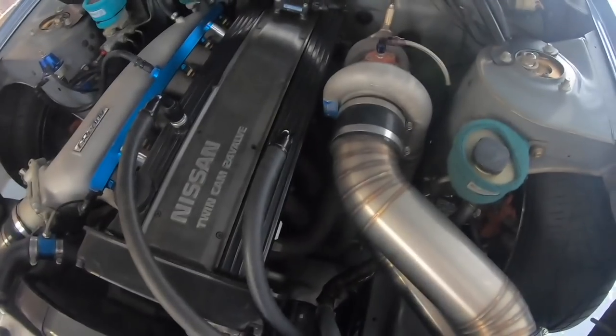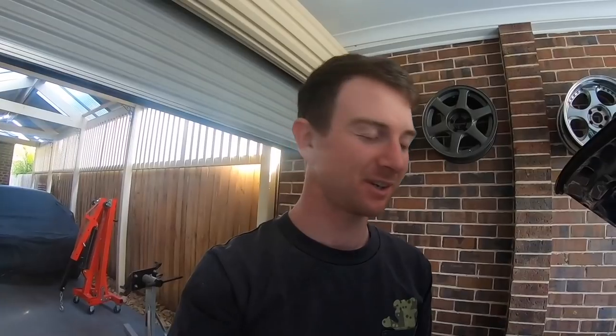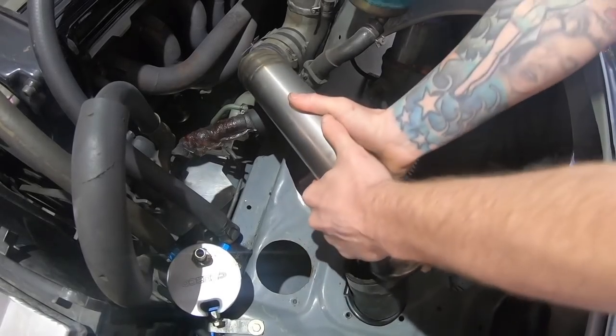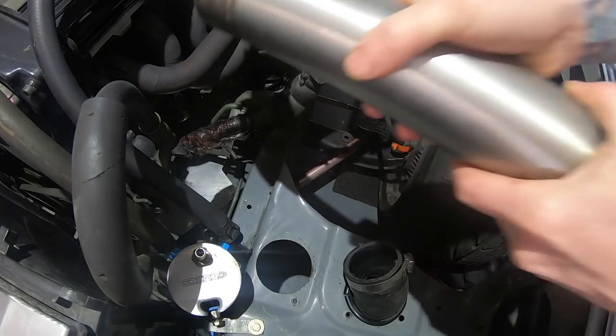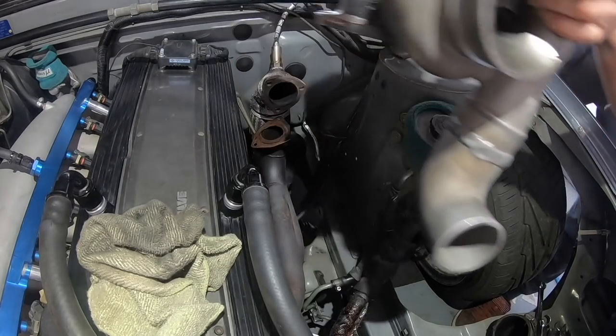The reason I'm doing all this cleaning - having just done the diff - was it was fucking hell, so greasy and mucky. It's been a long time since I've worked on a car that's just disgusting underneath. Giving it a good clean should make it more pleasant to work on. Today I'm going to tackle this hot side with the cracked manifold. For many many years this has had a slight crack in one of the welds down inside where all the pipes collect together - definitely a power loss. You can definitely hear it as well, though it does sort of close up once it gets warm.